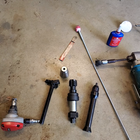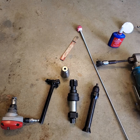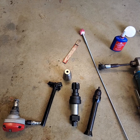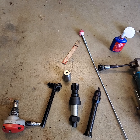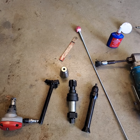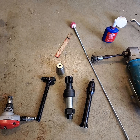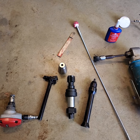What happens when the brass cracks, and that diesel gets into your coolant, is that just about every coolant seal is not at all compatible with diesel fuel. If you've ever pulled off one of the oil coolers on these powerstroke 7.3s, that blue gasket with the metal and then the O-ring around the inside, that blue, I think, is silicone. But for the record, diesel melts it. So if you have one of these things crack, you're going to have diesel in there, and those gaskets are going to start to leak because they're being melted by your diesel.